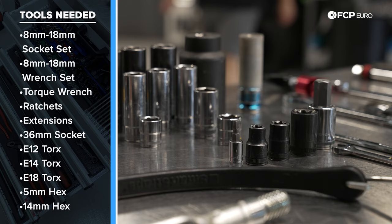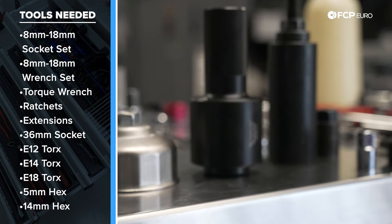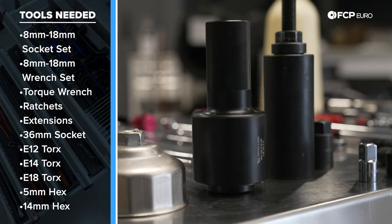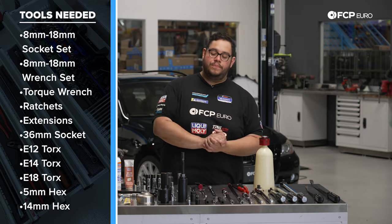A hex 14 mil for the diff plugs. We have a hex 5 for the beauty cover hardware. We have a BMW seal driver tool. This will be linked in the description below. This is specific to the seals on the differential, should you be replacing them, which I highly encourage you do.